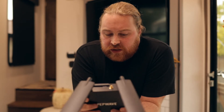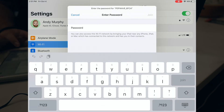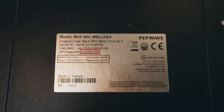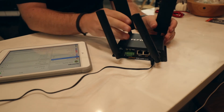Now we're going to take a device, connect it to the Wi-Fi the PEPWAVE is creating. You need a device that connects to Wi-Fi and has a browser. To find the Wi-Fi network name, flip the PEPWAVE to the back and look at the second line — the serial number. The last four characters of the serial number are the Wi-Fi name, so it will say something like PEPWAVE followed by a four-character code. Find that network on your device, tap it, and you'll be presented with a password. The password is found on the bottom of the PEPWAVE — it's labeled AP password and is also the last 8 characters of the MAC address. Type it in, hit join, and you're connected.